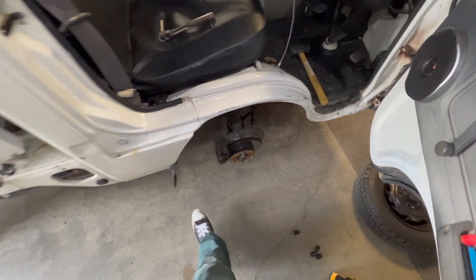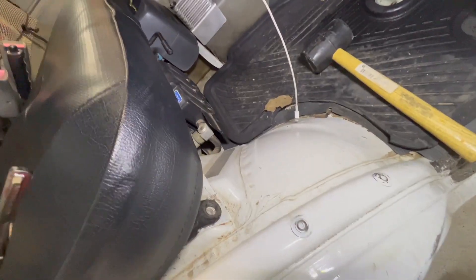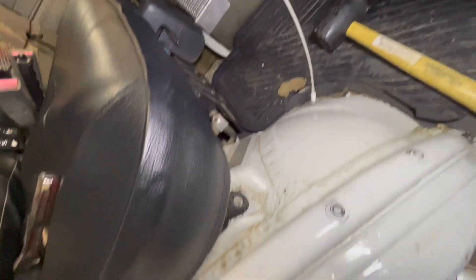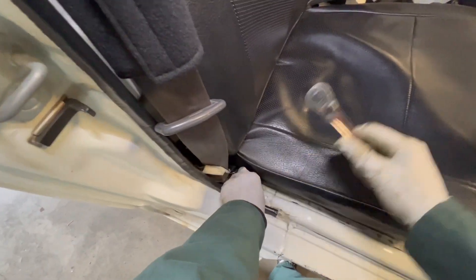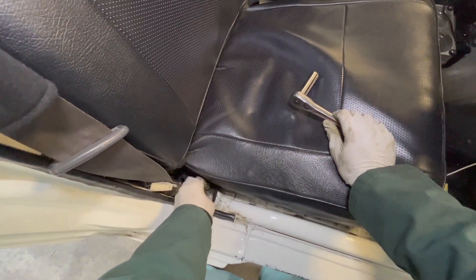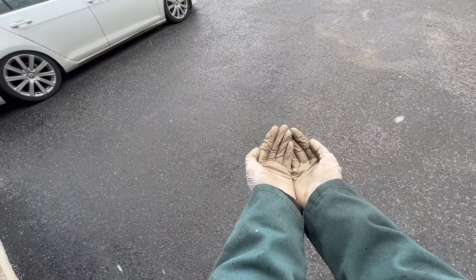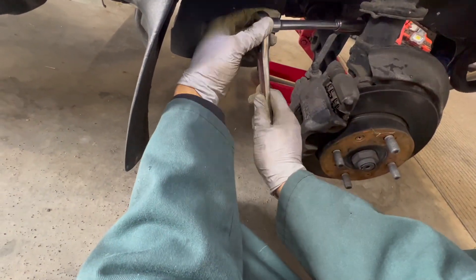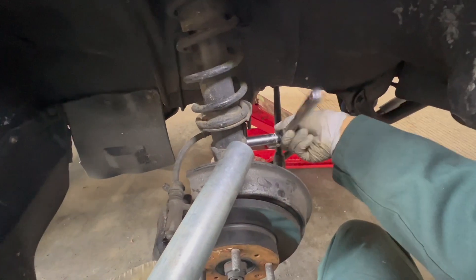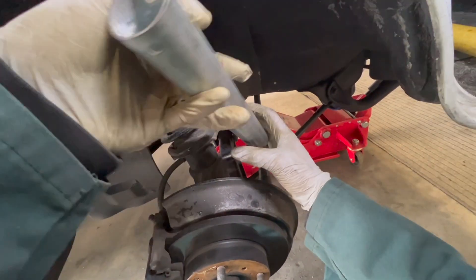Got the wheel off. Now I'm going to take off the seat. You can see there's two bolts in the front, one over here, and then I think there's another one below the seat belt. I have to get that last bolt out over there. It's freaking hailing over here. There's a 12 millimeter bolt holding the brake line, and I've got a 14 millimeter over here holding the suspension.